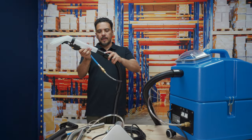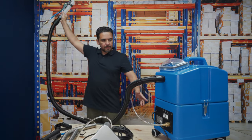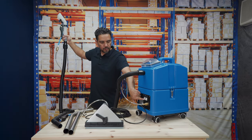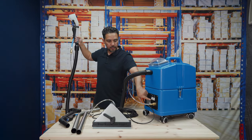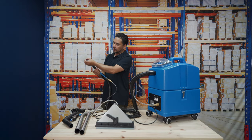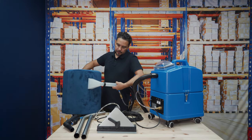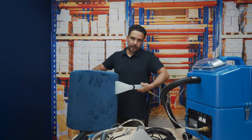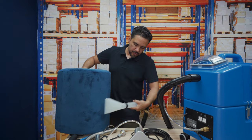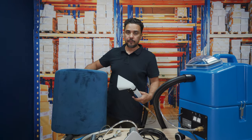The other end of the hose goes into your handle. Once that's set up with your liquid and shampoo inside, plug it in and turn both the vacuum and the spray nozzle on. When you pull the trigger, the water will just spray out onto the surface and you go ahead and extract it. There are all different kinds of spotters and chemicals you can use — that's up to you — but that's the essential method. Because there's so much vacuum, it'll dry very quickly.